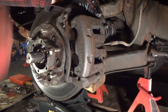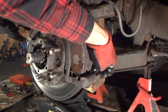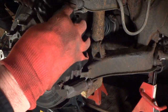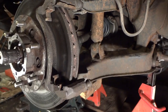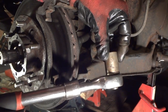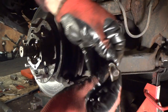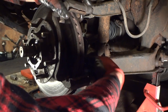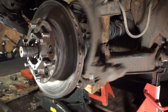Let's get the brake bracket off. Now I do have a couple of frozen caliper pins here — the bottom one is frozen but the top one is no problem. We'll get our brakes out of the way. I'm going to need some new pads pretty soon — they're about 50% down and have some cracks in them. On the back side there's a 22 millimeter bolt that holds this on. Here's the top bolt — it has a washer on the back. And here's the bottom one. The brake bracket comes off — put it to the side. Check your anti-rattle clips and make sure they're okay.